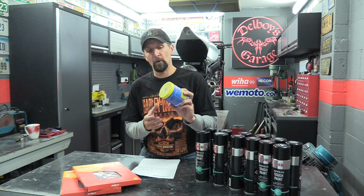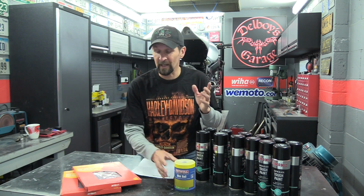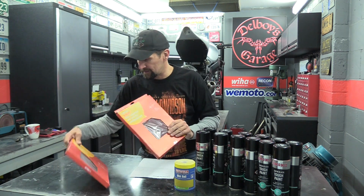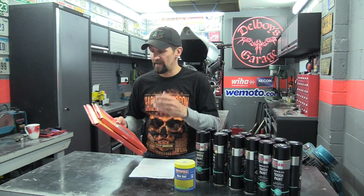The other thing was paper. A lot of rubbing down is going to happen, so I've got a big 10-metre roll of 120 grit. That's what I think is the right grit for this. It's already painted, it's already in its base coat, so I've just got to rough that back out, get it all flattened off, a little bit of work with the Dynaglaze, getting it absolutely right or as much as I can, and then I've got 2 packs of assorted wet and dry, 20 sheets in each, so 40 sheets of wet and dry. That cuts into 4, so effectively there's going to be shed loads of paper.